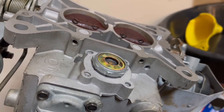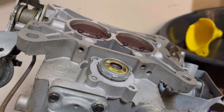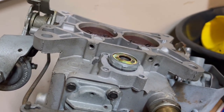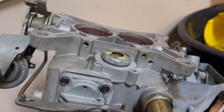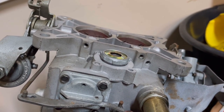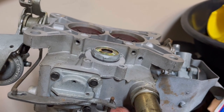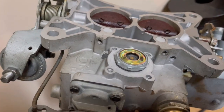We've taken the four screws off and you can see the power valve right there — you need an adjustable wrench to get it off. Also taken the two idle screws out. First thing you want to do is screw them in gently to count how many turns out they were. In this case, both were three turns out on both the driver and passenger side — make note of that so you can start there when you restart the car and adjust from there. Don't screw them in super tight, just until they're seated, otherwise you'll damage them. There they are, along with the power valve cover and gasket.